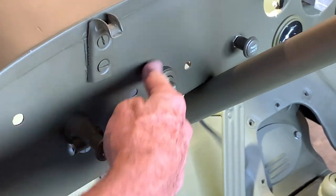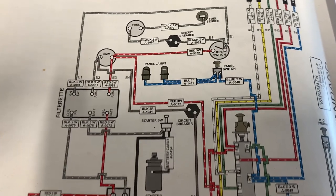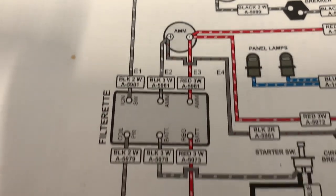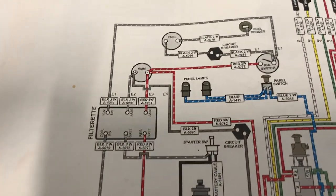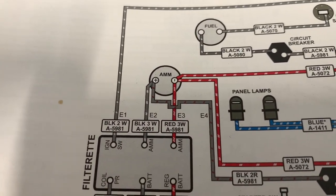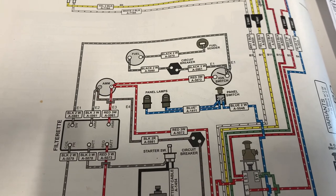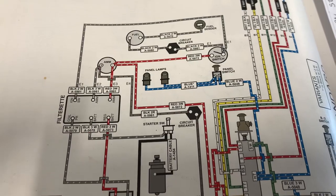For the time being, I'm going to leave the two leads loose underneath there — we're going to hook those up to various places. One of the ends goes to the ammeter, as you can see on the diagram in the Ron Fitzpatrick Jeep Parts catalog. There's a lot going on with that ignition switch, and I want to save showing you where all those wires connect for a future video. If you want to mark them with masking tape that's acceptable, but the color-coordinated wires should make it easy. Subscribe to the Team G503 channel and hit the notification button so you'll get notified when we release the next videos. Until next time, keep it safe and happy Jeepin'.